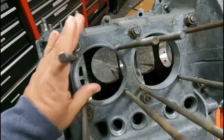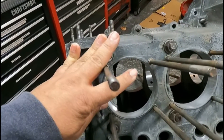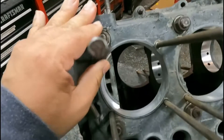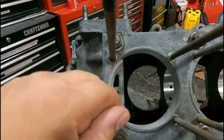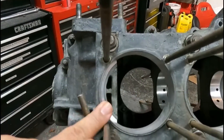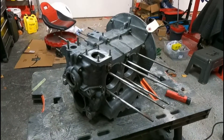Don't freak out if this is large, because the actual sleeve that goes in here has to be a little bigger, and then the piston is 90 and a half. I already test-fitted that earlier when I got the case, just to be sure it was bored correctly — and it's fine. This is your sealing surface here, and it has a little bit of a lip. A lot of times I'll machine this down to get the right deck height, but in this case I'm glad it does have a lip, because we're using a different kind of crankshaft — something that CB Performance makes. I'll show you that later.